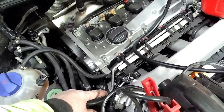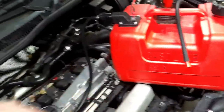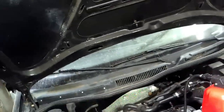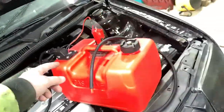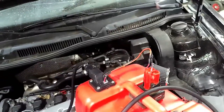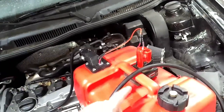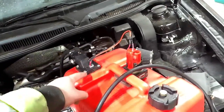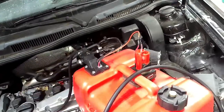Now, if I were to just put regular fuel pressure into this line to start the car, then any excess would actually go from this tank into the back fuel tank. So that's the only drawback, is that you're going to use gas at a higher rate unless I put the fuel return line somehow into here. Maybe cut a small vent hole or something in there and put something in there that I can put a 5/16 line in. So anyway, there's you a portable fuel injection gas tank with a fuel pump in it. Actually, it's got a Mazda fuel pump in it, which is 40 to 60 PSI regulated.